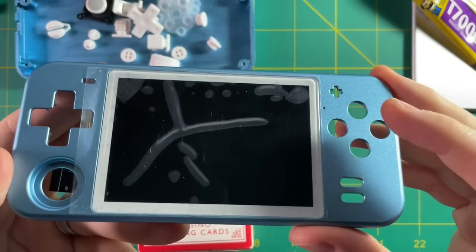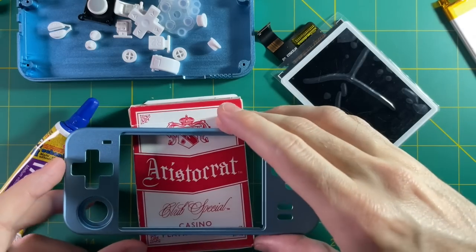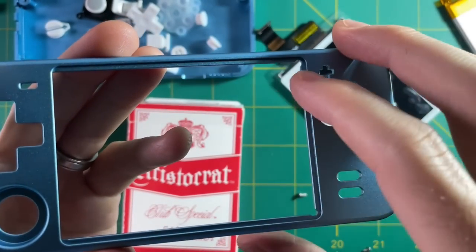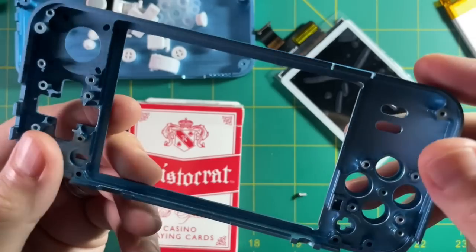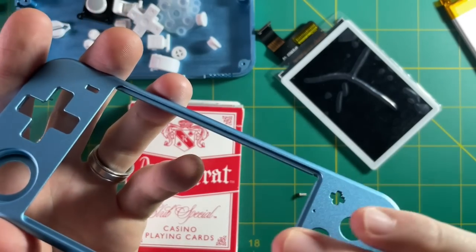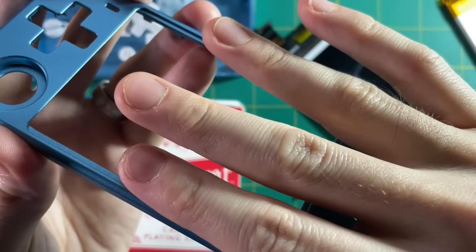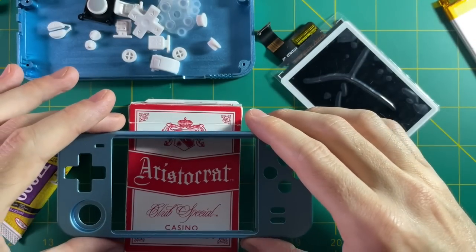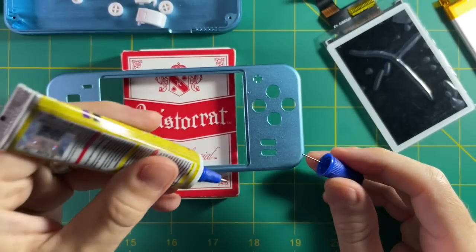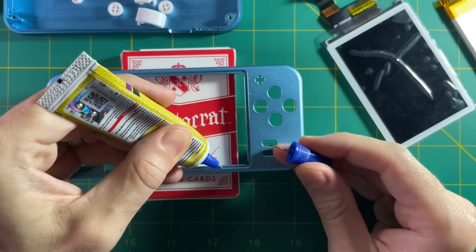This is what it's going to look like when it's fit inside the device itself. If you look on the inside of the case, you'll see three different spaces where you're going to put the glue and rest the screen. On the other side you just latch it in — basically slide in the side with the ribbon cable and press it down onto the adhesive. We're supposed to use T7000 adhesive here, which is a rubber adhesive that makes it easier to remove later. You don't want to use something like super glue — you can use this or double-sided tape.